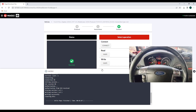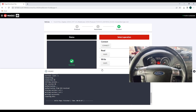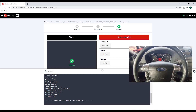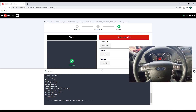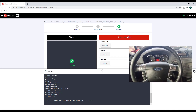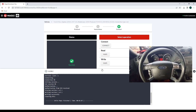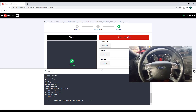A few years ago it was a problem reading this ECU, but now it's not anymore — it's so easy. You don't need to take the ECU out from the car if you want to work only on the map. I was asked how I read the C206, and this is my answer: I read through OBD and also write — it's not necessary to take it out. If you use a clone, you can do it with Scanmatic clones or also with KT200, which you can buy on eBay and AliExpress. They can do this job too, but you can read only in boot mode.